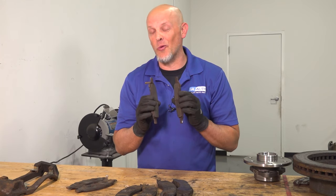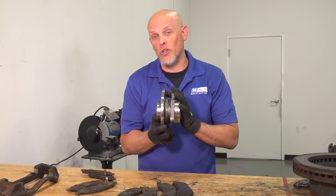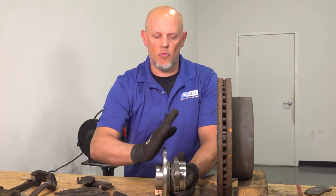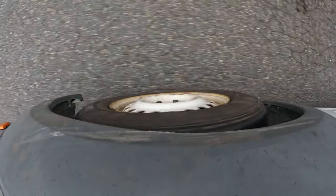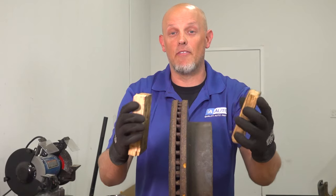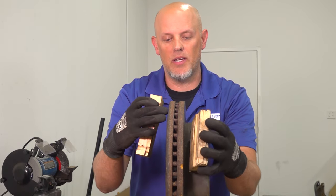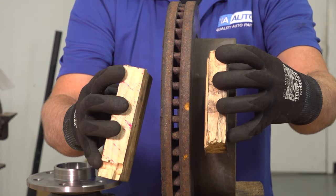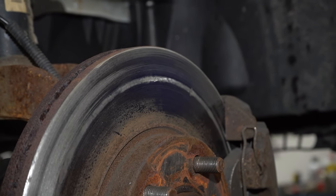Let's talk about reasons why these are worn this way. These ones that look like a wedge of cheese — a little bit thicker on one side than the other — could be a potential bad wheel bearing. If you had a wheel bearing with some play in it and the hub was sitting at an angle while driving down the road, the pads are not going to squeeze the rotor correctly. If these pieces of wood simulate a brake pad going down the road with the hub, the rotor is going to be tipped. The pads are going to push on the rotor unevenly — one side wearing at the top and one side at the bottom.